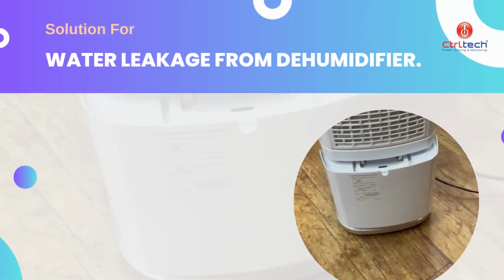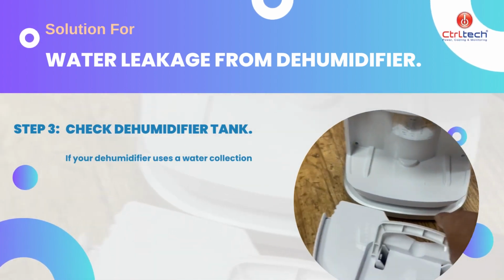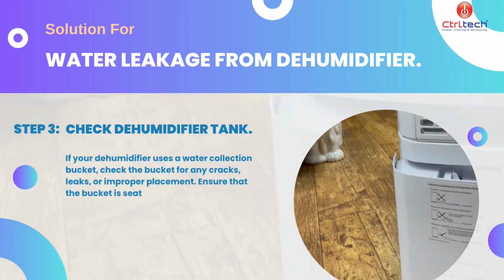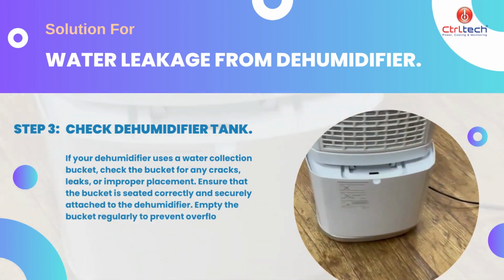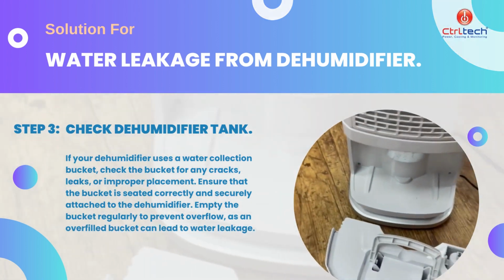It is possible that the leakage is from the condensate tank of the dehumidifier. If your dehumidifier uses a water collection bucket, check the bucket for any cracks, leaks, or improper placement. Ensure that the bucket is seated correctly and securely attached to the dehumidifier. Empty the bucket regularly to prevent overflow, as an overfilled bucket can lead to water leakage.